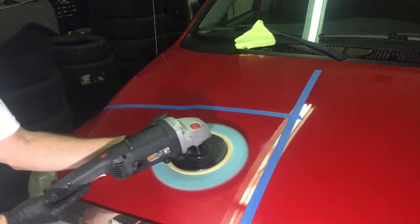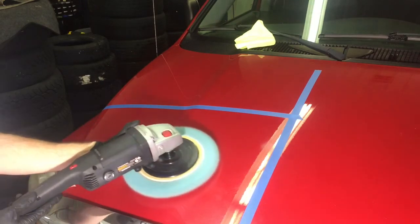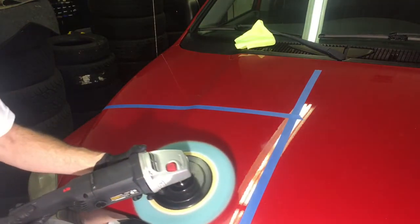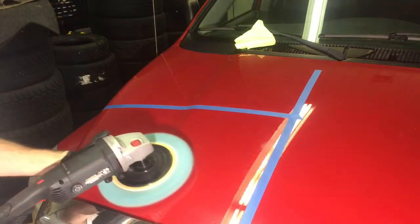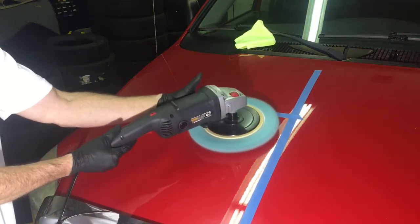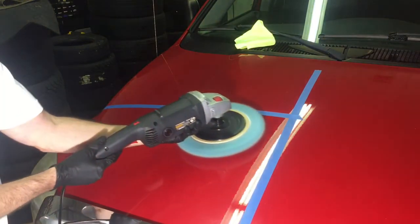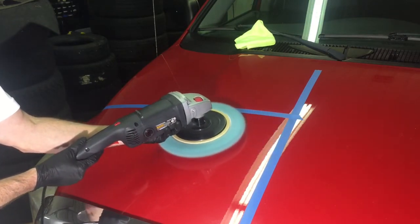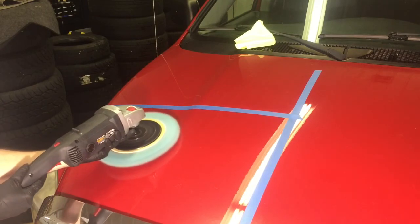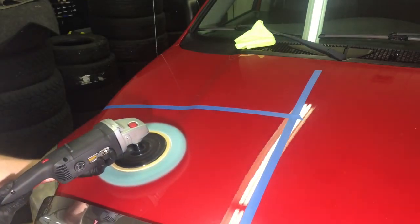When you get to contours and curves of the panel, especially with this tool, don't fight it — let the tool navigate itself through the contour and just guide it. It's usually the peaks of these contours that have the least amount of product, paint, and clear. Angel Wax allows for a quite long working time, and before it flashes I want to get some nice slow passes. You can do this step until you acquire the finish you're looking for.